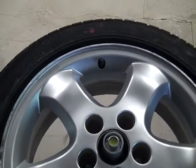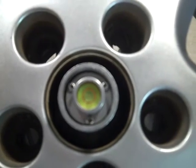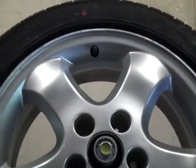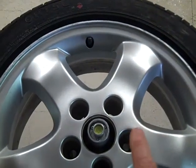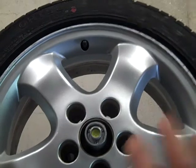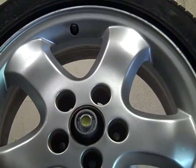Wheel number two: when I mounted it — which can be a little tricky by hand — I got the red dot pretty close to the valve stem, and again the bubble is right in the middle, so no weight is needed again. I'd also mention that when I put the tire on the machine, I line the valve stem up with my 'north' marker for reference, since you end up taking the wheel on and off to double-check and possibly add weights.